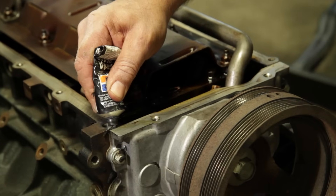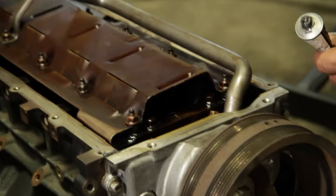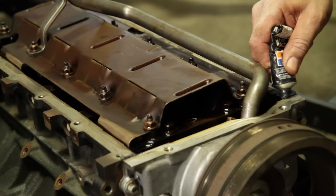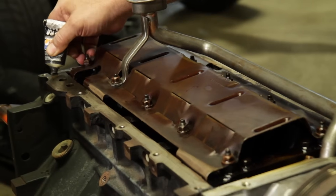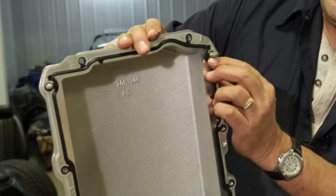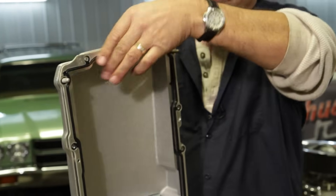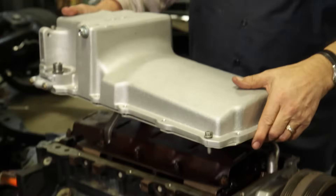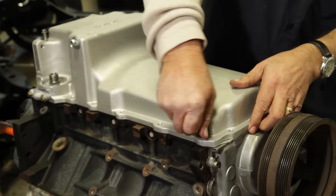One of the final steps before bolting up the pan is to put a dab of RTV at each one of the four corners. The instructions tell you exactly where it goes, and that's crucial to make sure the oil pan gasket seals up well. Now we're ready to put the oil pan in place, but here's a little trick first - with the new gasket on, put a bolt in each one of the four corners. That way, the rubber around the gasket will hold the gasket in place while you invert it, set it down, and you're good to go.